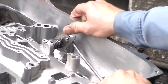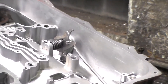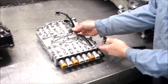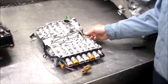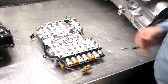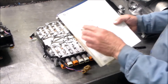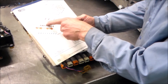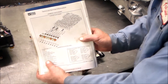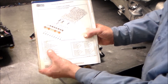Here is the park rod assembly with the big barrel spring on it. Here is the MV2 solenoid, and this is the sub-harness that connects into the TCM. This is the park release mechanical valve. The MV3 solenoid is the park hold solenoid. In the lower section of the valve body, the valve I have circled is the parking pawl release valve.